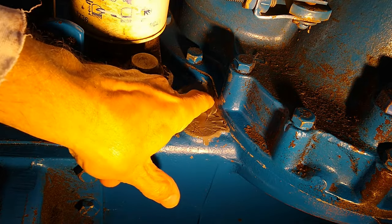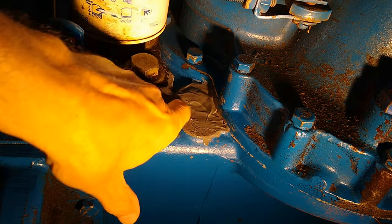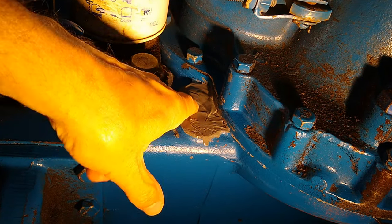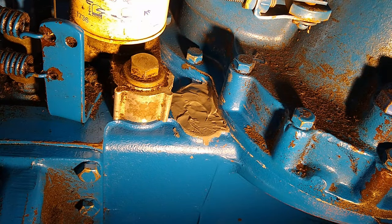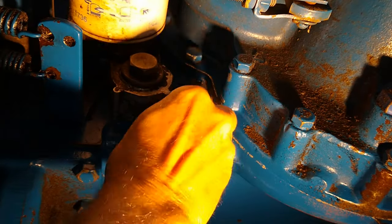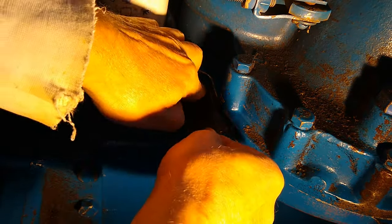But you can see the outline of that soft plug there, which means it's very thin right here, which is the spot where it leaks the most. So I'm going to take a little emery cloth, rough it up, and then put another coat on over it. Just want to provide it a rough surface to grab onto, give it some tooth, as they say.